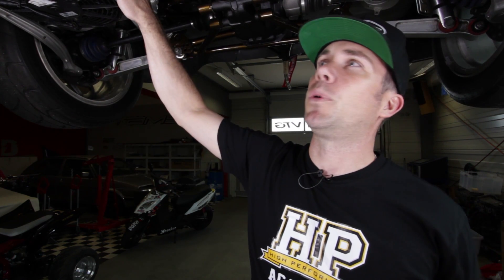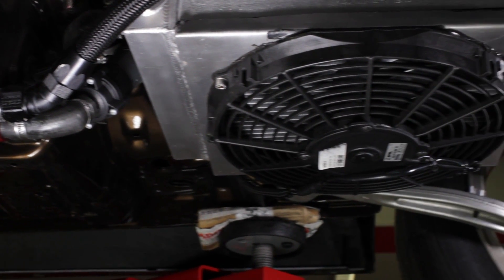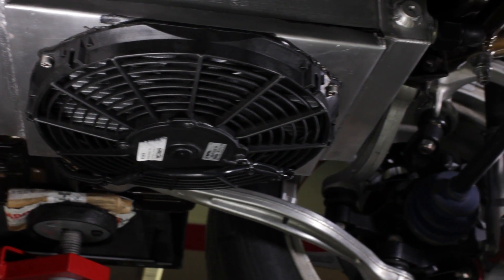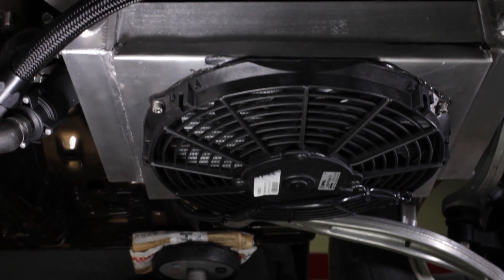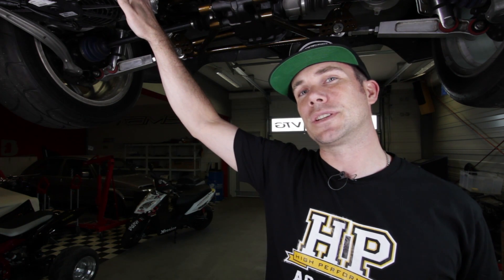Another feature back here is Paul's rear-mounted radiator. With a methanol drag engine, we're only running this engine for perhaps 10 to 15 seconds at a time, and methanol tends to stay very cool anyway. We've run these cars in the past with no radiator at all — that can work, but it puts a lot of stress on the driver because you've constantly got to watch engine temperature and decide when to start the car to move into stage. If your opponent has a problem and messes you around on the lights, you can have trouble controlling engine temperature. So for the small amount of complexity and extra weight, having a small radiator is just nice for peace of mind.